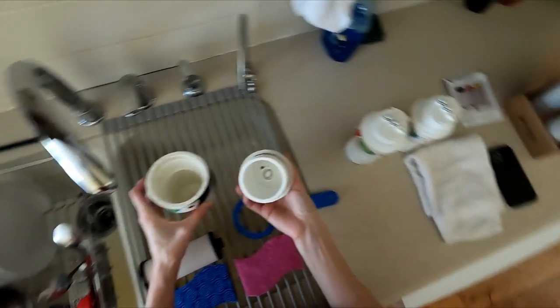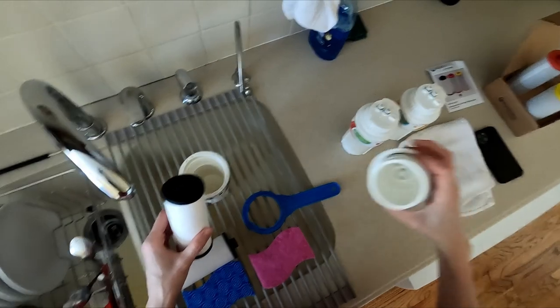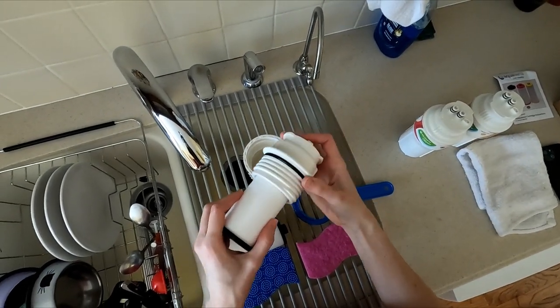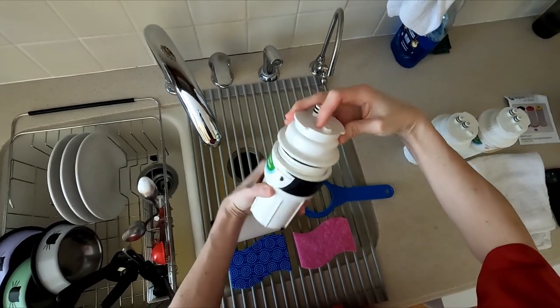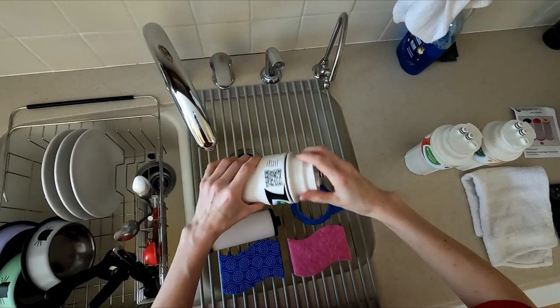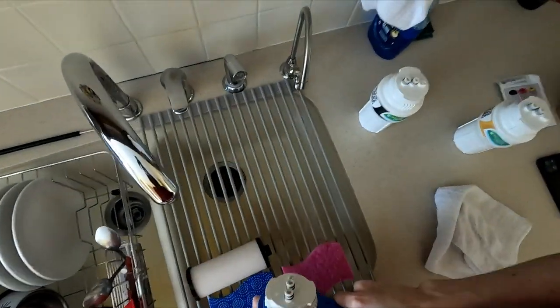The filters are color-coded to match the color of the filter body. To install the new filter, push the top of the filter into the center of the filter body top — it shouldn't fall out when it's in place. Screw the top back on the filter body and tighten it by hand only. Repeat this process for the other remaining filters.